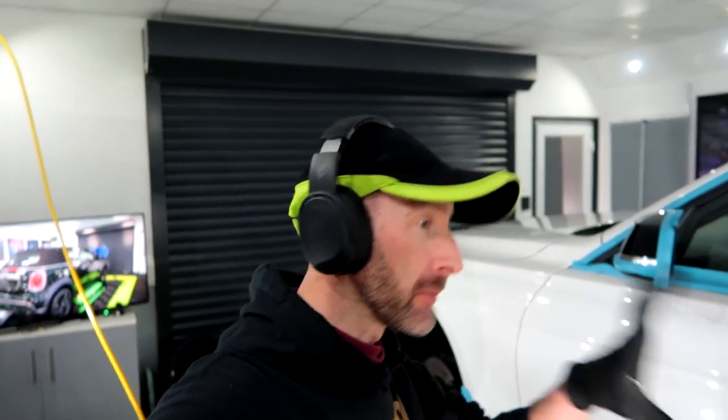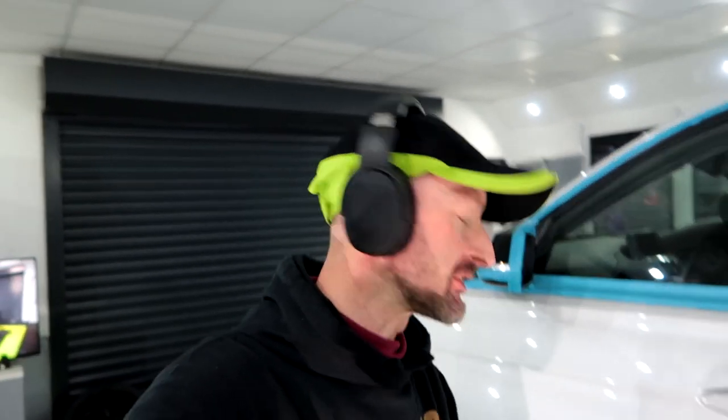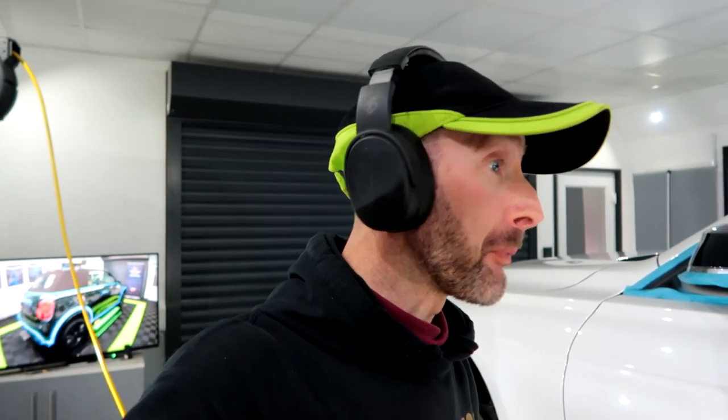First little update on the BMW 3 Series. So, done my test panel and a fine polish and a fine pad did absolutely nothing. Medium pad, medium compound, pretty much nothing. So, we've stepped up to a Meguiar's microfiber cutting pad and Gyeon Compound Plus. And it seems to be, it's not perfect. There are still scratches in there. And please remember, this is only an enhancement. This is not a correction detail by any means. But I'm very happy with the results.